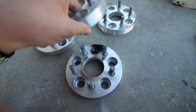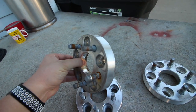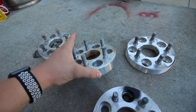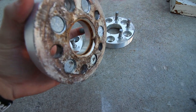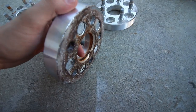This one also had a little bit in there. On another side note, these are kind of rusting out. These are eBay spacers and I wouldn't recommend buying these either because they're classified as cheap parts. You can see on almost all of the spacers there is at least a little bit of rust, and they're definitely going to have to be replaced. This one's really bad in the hub-centric ring area — kind of really grimy in there. Those spacers are pretty trashed and I definitely had to order new ones.